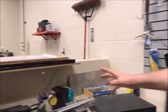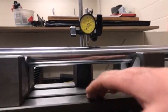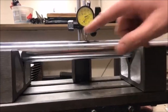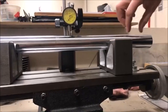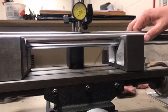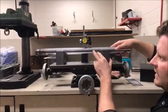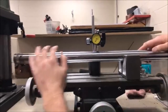Here's the overview: we're going to do it just like the service manual showed with the V-blocks. The other thing I want you to notice is that we're on really solid, heavy supports. When we did this on a workbench, just experimenting - literally just pushing on things - would cause deflection in the needle. You also want to think about where to measure. You can see this witness mark here where the triple tree went. Where this would really bend is below the bottom triple tree. So the best place to measure is here, but you should also check here and here - all over the place. I want to make sure I'm not falsifying the reading.